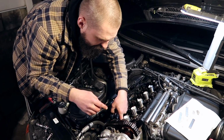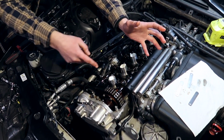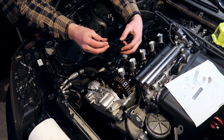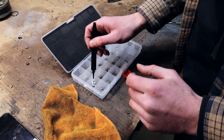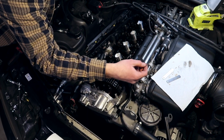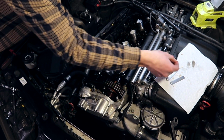So I'm going to take the shim previous to this one, because there is no shim size between this one that we have now and the one we tried previously. The one previously was our best bet because this one exceeds our limit. So 2.24 in this case, a little bit too thin. We're going to go with a 2.28. That's going to be our best bet. We're going to double check. 0.33 should not fit. Which it does not. That is good.